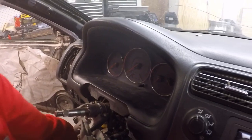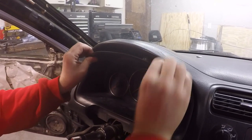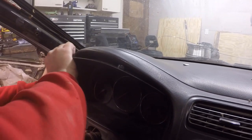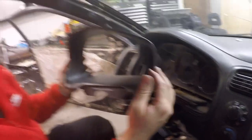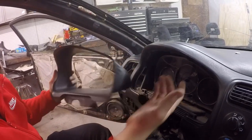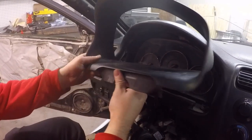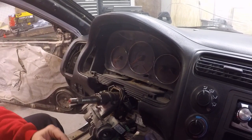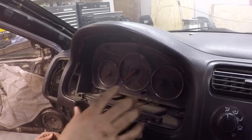Managed to get those two screws out — they're on the floorboards for now. This trim piece should just slide forward. It's a pain in the butt — you have to grab at the top and pull; it's got clips on the back that need to come straight forward. I ended up taking a pry tool and wedging it underneath to lift it, since it hooks on the dash edges. Managed to pop that out. Next up the gauges: there's a screw up top and two down here, then it should come forward and I'll unclip the wiring harness.